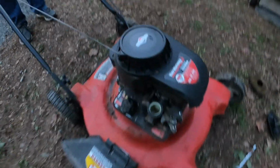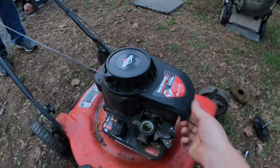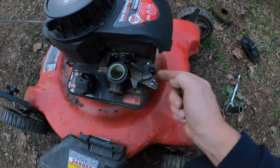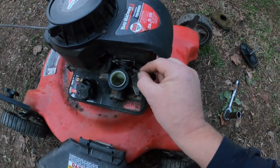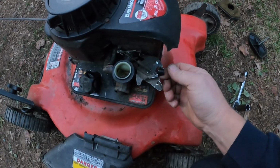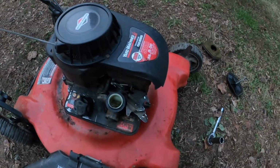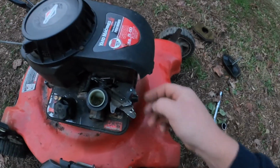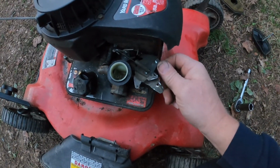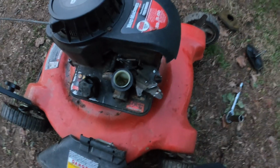Nest or something. Why do you say that? Why is it over revving? Well, this linkage is all bent up down here. Somebody must have bent it, and it's pulling too much on the governor. So, can I get a pair of pliers or needle nose pliers or something, and let's bend this up and adjust the throttle so it's not over revving.